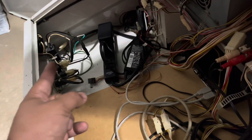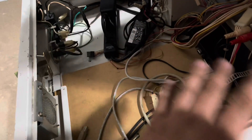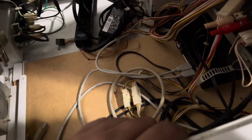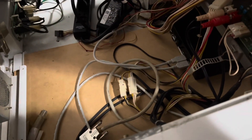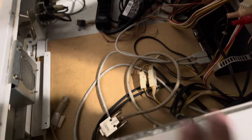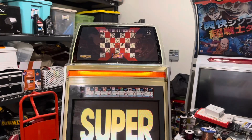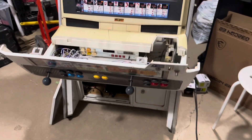This cabinet needs both switches to be on to work, but because I kind of bypassed one switch, it's not that big of a deal. I can just run it on a smart plug set to always on, and the smart plug will handle turning it off. It has all the original stuff to run NAOMI — all the wiring, the power supply, everything to run a NAOMI or any JVS setup — but I'm not going to use JVS so I'll cover that before putting it all back together.